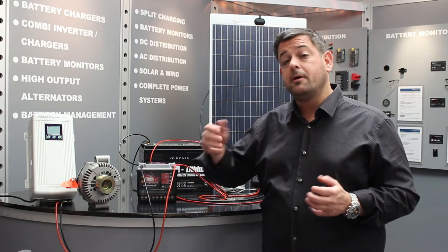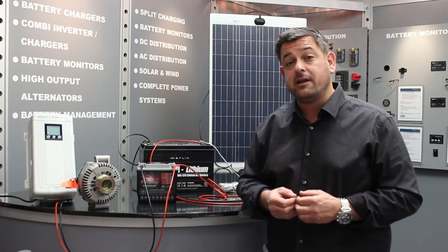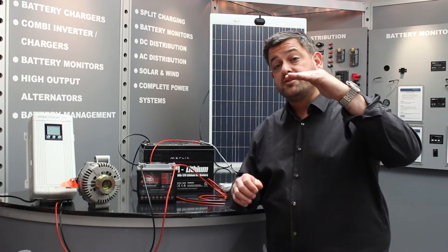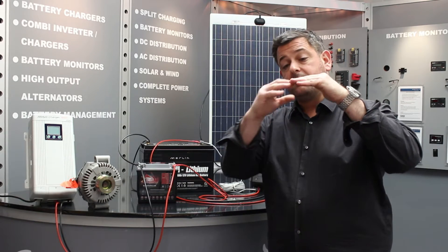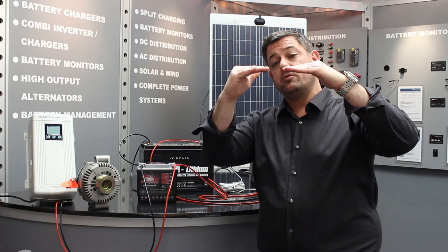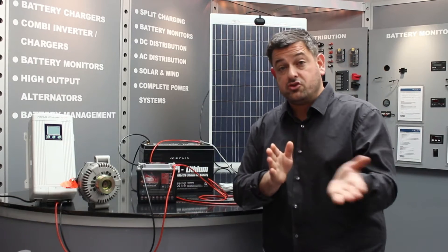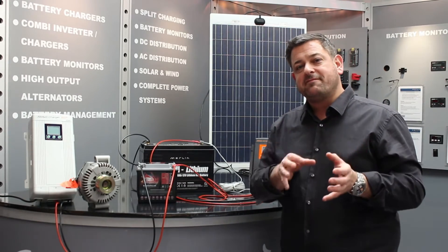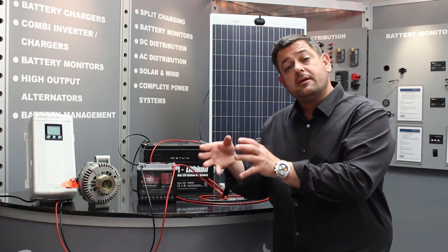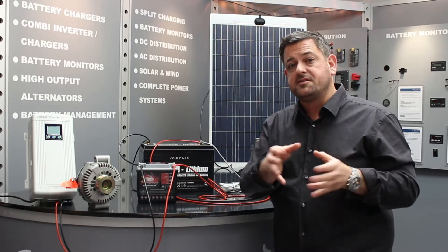When you start the engine up, the output is continuous at 14.4 volts. From that, what we can do is we can trigger voltage-sensitive relays, battery combiners, etc. The way that they work is that you fire up the engine, the engine battery starts to charge, it reaches a trigger voltage. We're then connecting the auxiliary batteries — both charge up together — and then when you start discharging the batteries, they will disconnect so that you can fully discharge your auxiliary battery without compromising engine startability on your engine battery. When you're trying to charge batteries of different technologies, the AGM battery requires very different charge voltages to the lithium battery in the rear of the vehicle, and that's why you can't connect them together in a standard split charging system.